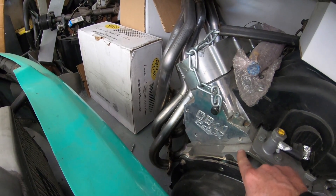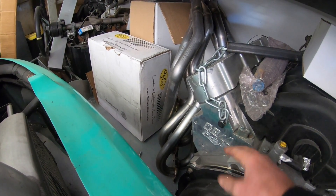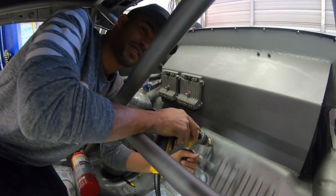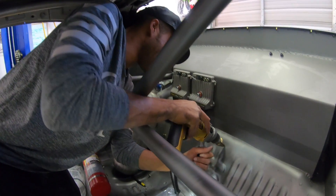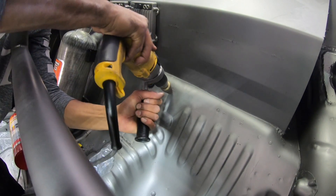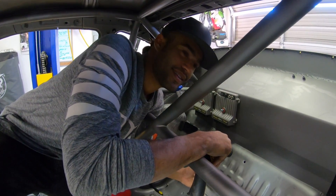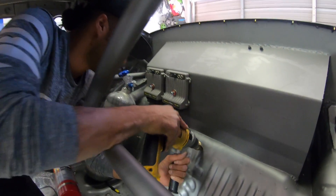On the driver's side, the cylinder head is offset a little bit. So if we punch the wiring harness out there, we get a bit of space to work it between the firewall and the cylinder head. I kind of like step drills over regular drills sometimes, because you can correct an off hole — you can walk it in one direction and force it that way.